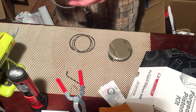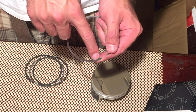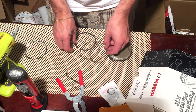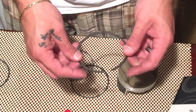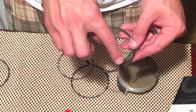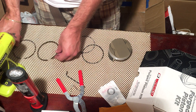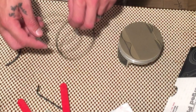For the Wiseco pistons, you will have a number on them. There will be a number, a marking, a letter — anything. That will be the side that faces up. The shinier ring goes on top; it's usually a little bit thinner. Then you have your slightly thicker black ring — you can usually feel that it's a bit sturdier. Again, it's going to have some lettering or numbering indicating which side is pointed up, and it's got a little bit of a bevel on the bottom end. That's the second piston ring from the top down.